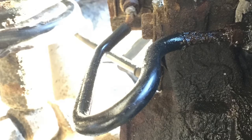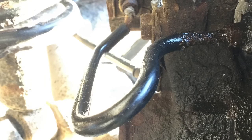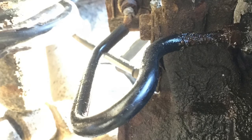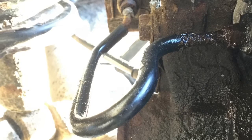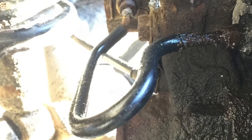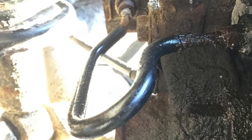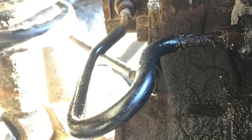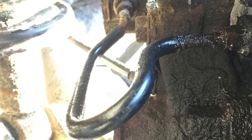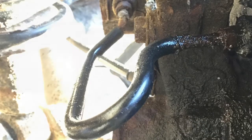The reason I need to change the wheel cylinder is because that 10mm nut was seized on there because my car is rusty as hell. If you look right to the right of the nut, you can just barely see the little piece that the line threads into — that is the wheel cylinder inside the brake, and that's what we're going to be changing today. As I was taking it off, the damn thing cracked.